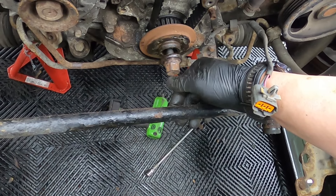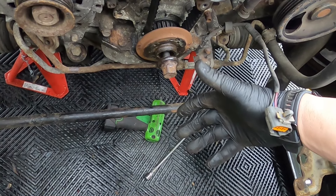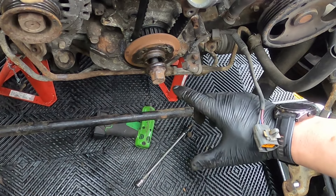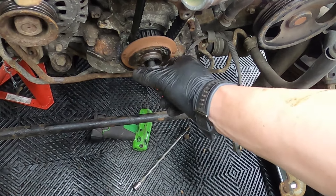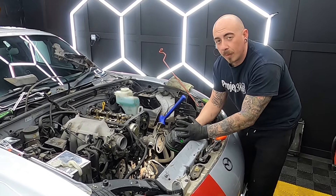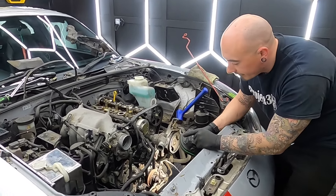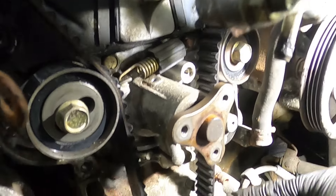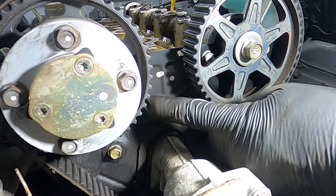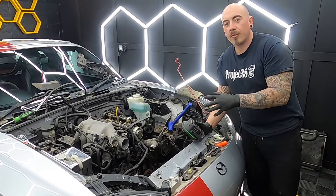Robbie sat in the car and we had been trying for a while but this was completely seized. So we gave up and in the end we had to remove the anti-roll bar — that's just two bolts either side and the anti-roll bar can drop down and out of the way, which allowed us to get an impact gun in. With the anti-roll bar in its usual position you can't get a socket and ratchet in the gap. I'd advise to go for the breaker bar method first before using an impact gun, but for us this was so seized the only thing that could remove it was an impact gun. Now we can remove this bolt, make sure everything's clean and put the bolt back in. Now we're almost ready to remove the timing belt.